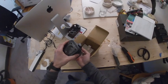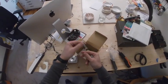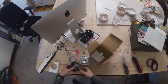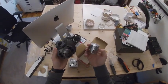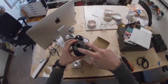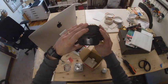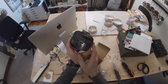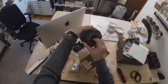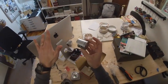Inside the kit you're going to have your circlips, your wrist pin, and a new wrist pin bearing — you don't want to lose that stuff. The piston and cylinder does have some oil in it already but we're going to add some more. It does not come with the studs for the exhaust. Give the cylinder a look — everything should be nice and cross-hatched in there. Rub your finger along those different ports and make sure there's no crazy sharp edges that are going to scratch up the side of your piston.